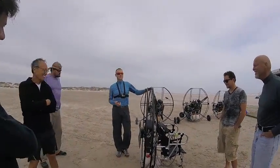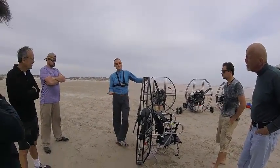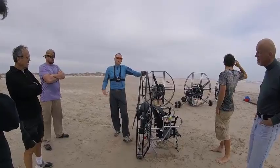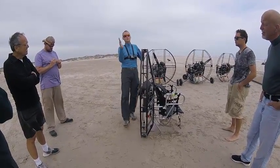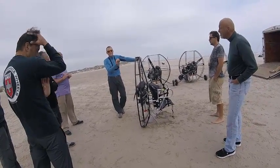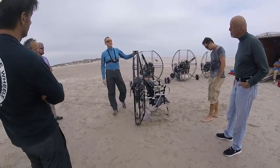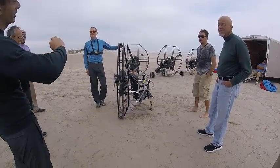It's kind of hard to damage the motor with tuning. If it's running well, it's good. If it's so far out of whack that it would damage the motor, it's generally running like crap — so you'll know there's a major problem. Small fine adjustments don't make a big difference for power output once it's running well. After about 15 hours you could lean it out just a smidge to get a little more autonomy, but that's only really worth considering if you've got a lower-powered motor trying to maximize output.